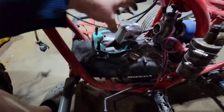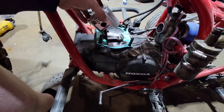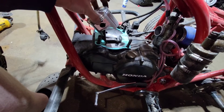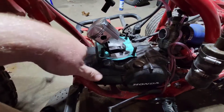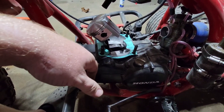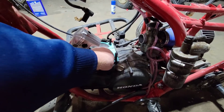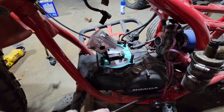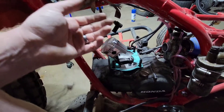Something to do obviously before you try putting your top end on — at least on a two-stroke — is that there are certain places that the rings have to sit down in. I just got both of those seated so I can squeeze in tight. Also make sure your gaskets are on right. I actually put this base gasket on wrong the first time I set it in there. Mating surfaces are all clean. Now I'm going to go ahead and try to throw the cylinder in.